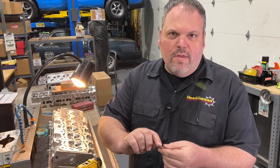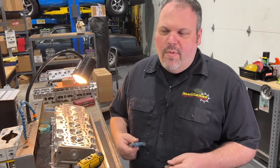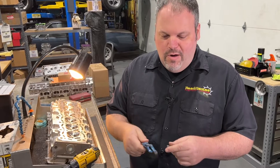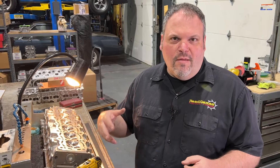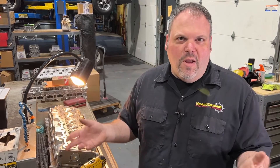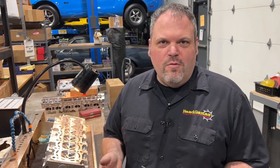To get this right, you need to know the valve stem size. You might see catalogs listing something like .235, but you really need to know the exact number because tenths matter in this arena. Take a micrometer and measure the valve stem — we're at .235 for stem diameter. Manufacturers use different stem diameters, so you can't just pick something for a 2JZ and expect it to work universally. Some manufacturers we won't even use because their stem diameters are all over the place. We get custom reamers made from Dakota Parts Warehouse for the specific valve we're using.